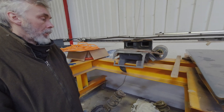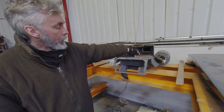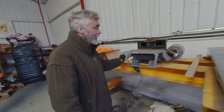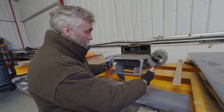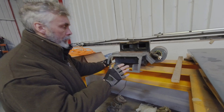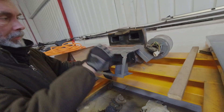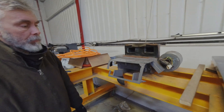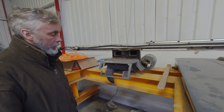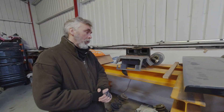Is it just a question of popping in an up-to-date resistor-style heater inside that box? Very good indeed — what we're going to do is use a PTC heater, a ceramic-based one, because they're very reliable. We'll put a new motor on it so it blows air across the PTC heater, and that'll blow warm air through to help demist the window and keep you warm. The most efficient way of keeping an EV occupant warm is to have seat heaters.